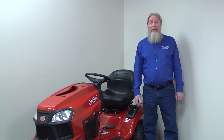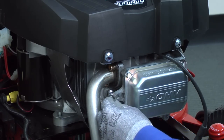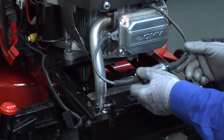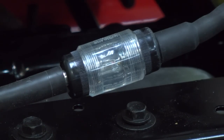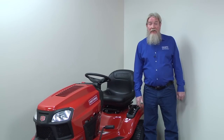If the spark plug looks okay, use the spark plug tester to see if the plug is getting current from the ignition coil. To test it, install the spark plug and connect the boot of the tester to the spark plug. Connect the engine spark plug wire to the other end of the tester. Crank the engine and see if the tester sparks. If the tester doesn't spark, it's likely you need to replace the ignition coil. If the plug sparks, that means the ignition coil is good, but the timing for the spark might be off.